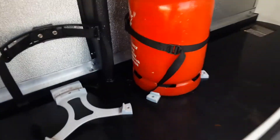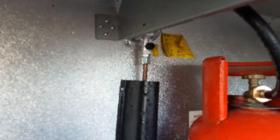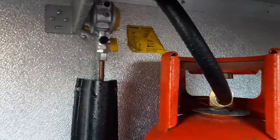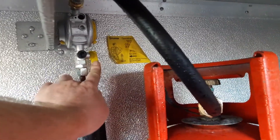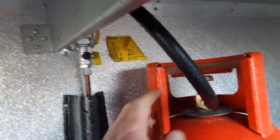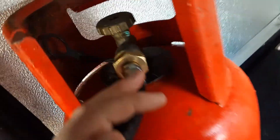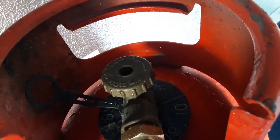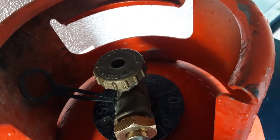In the front locker you've got your gas regulator on the bulkhead and the gas pipework coming to the bottle itself. Next to the bottle you've got a yellow shut-off valve so you can isolate the gas supply from past the regulator to the caravan. On top of the bottle you've got gas open and gas closed — gas open is gas on and gas closed is gas off.